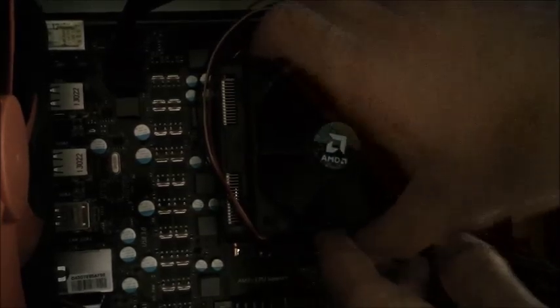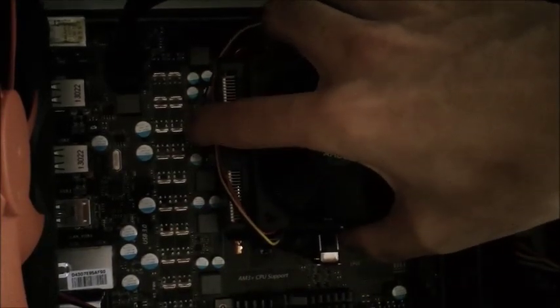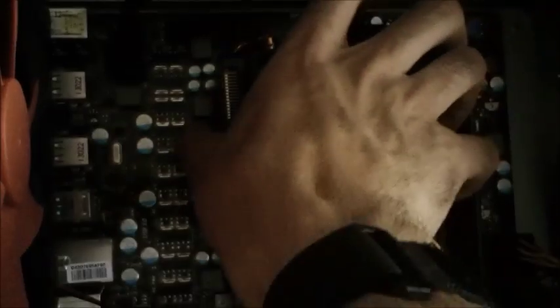It'll take a little bit of force — though it shouldn't take a whole lot. It's not coming out too easily; seems to be stuck. You want to be very careful because you don't want to end up pulling out your CPU with it, because that would be very bad for the system. There we go. Good thermal compound — it just had it attached pretty well.